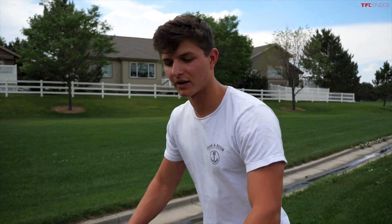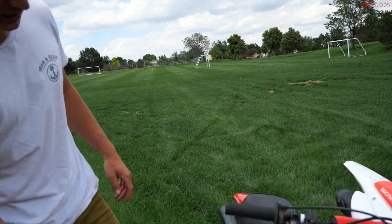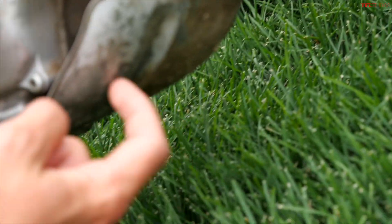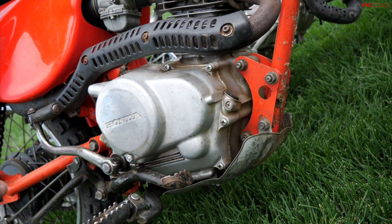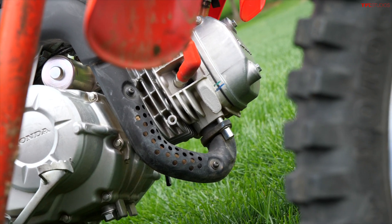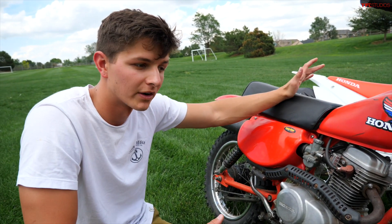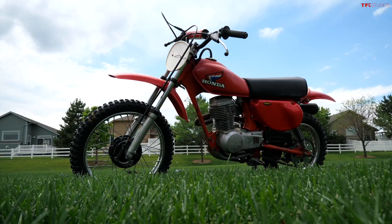That's because the XR80 is used to tackle gnarly trails — it's a great trail bike because you're never intimidated by anything. If the bike can't get up something, you just stand up on top of it and let the bike walk up as you shuffle all over it. Something else interesting about the XR80: the ground clearance in the middle of the bike is pretty similar on both, but on the 110 it's the exhaust pointing at the ground whereas on the XR80 there's a skid plate. I'd definitely rather bash that into a rock. A skid plate is nice, but since I don't plan on keeping the 110 long I'd just smash the exhaust.